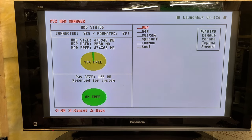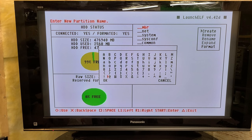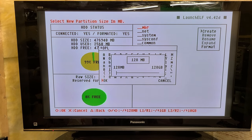Okay, we need to create an OPL directory — they call it a partition. I actually don't think I need to do this part but I'm going to do it anyway, because I'm going to continue booting from the memory card. As far as I understand, you can install Free McBoot to the actual hard drive, but I'm not going to do that because I'm also going to use that memory card as an actual memory card. It said hard drives less than one terabyte should be set to 768, so that's what I'm going to do.